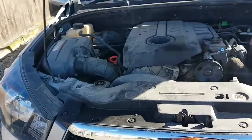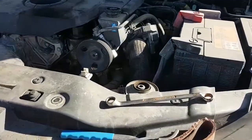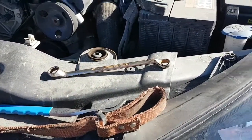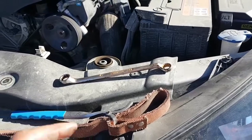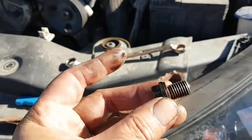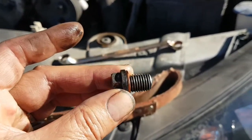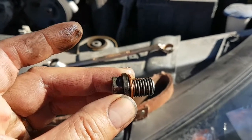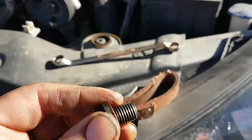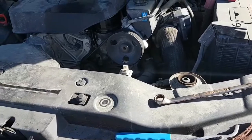I've already gone ahead and done a few things. The two tools you'll actually need are a 14mm ring spanner or 14mm socket of some kind — that's to take out the nut underneath for the drain. When you get your parts, you will get a copper washer which needs to go back on, and you'll also get an o-ring for the filter, which we'll get into in a bit.